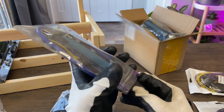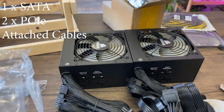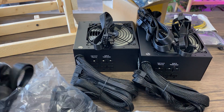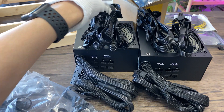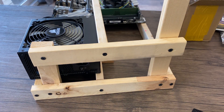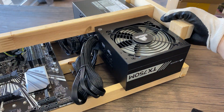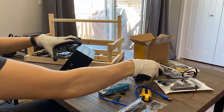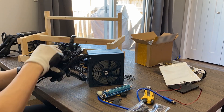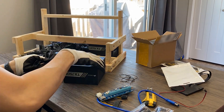Next let's open up the risers. Then let's get the power supplies organized. The only cables we need are one strand of SATA, two PCIe, and the non-removable 8-pin and 24-pin connectors per power supply. We'll connect three risers to each strand of SATA connectors for symmetry. For this setup one power supply will face up and the other will face down because of the location of the plug. We can keep most of the cables in their twist ties. I connected the primary power supply — the face-down one — to the motherboard: the 8-pin in the top left, then both 24-pins to the adapter and then to the motherboard. After that I connect the SSD and the power button.